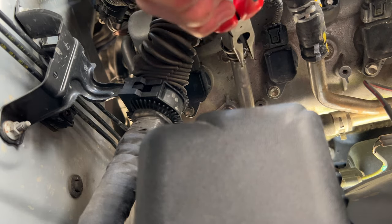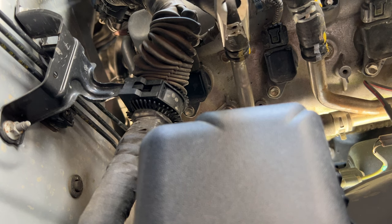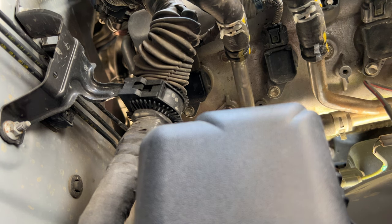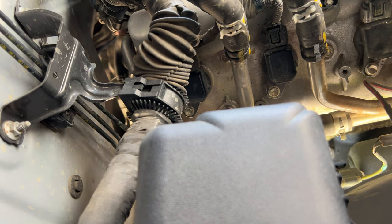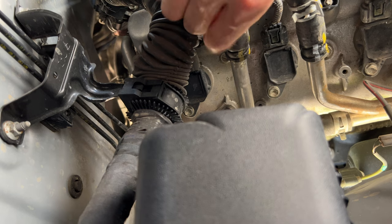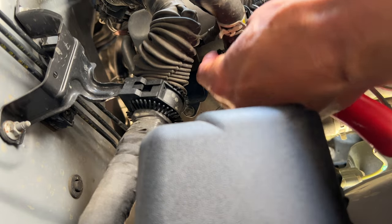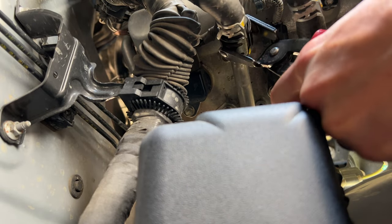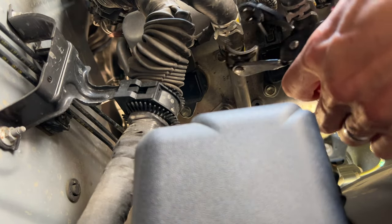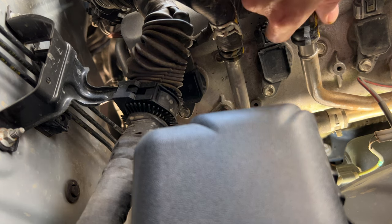It's okay, I don't have a lot invested. If you just want to hold the clamps up here on the hose, it's just fine — I'm sure that's going to work without a problem. Now we just got to pull these hoses off. They're not even stuck. There are special pliers for grabbing heater hoses, but if you just give it a twist like that, it kind of breaks it free and makes it easier to come off. Just let them drain into the bucket.